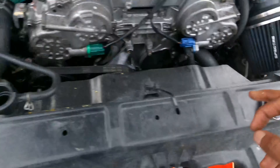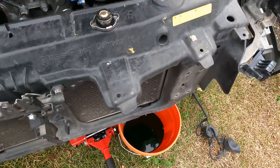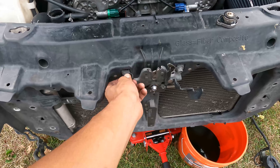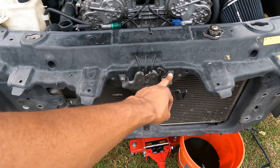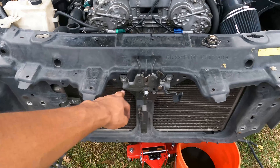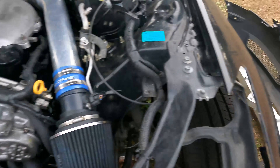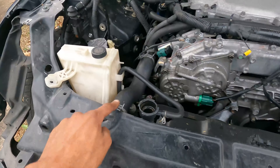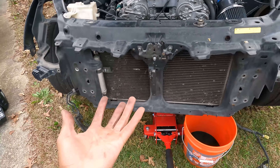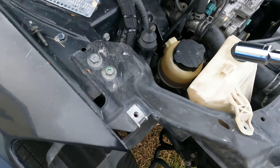While you've got that draining, pop off these tabs right here — just grab it with the needle nose, twist it and pull it up. Once you get to this point, these two bolts have to come back off as well to allow this to come off, then you can slap them back on after this phase. Leaving the hoses attached will make the whole assembly come off easier and you can do it one person instead of needing two. These are just 12 millimeters, so go ahead and bust those off.